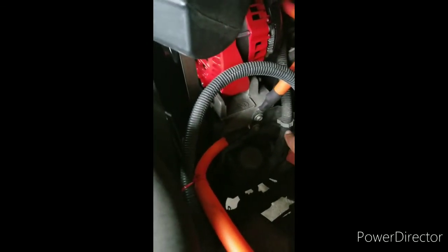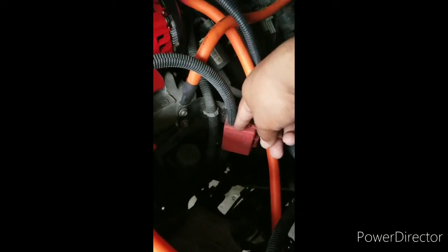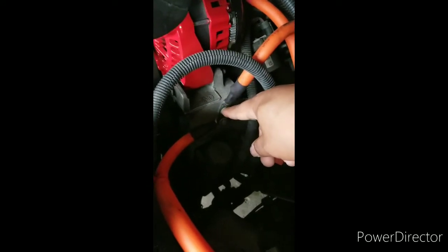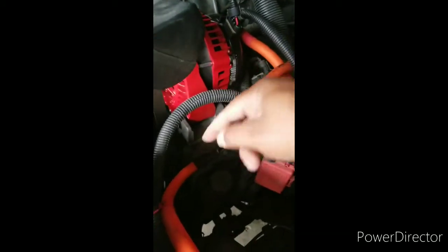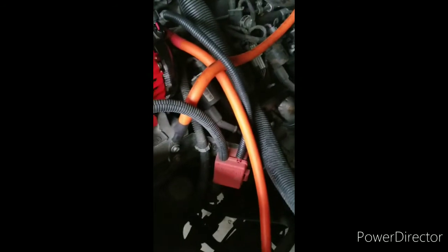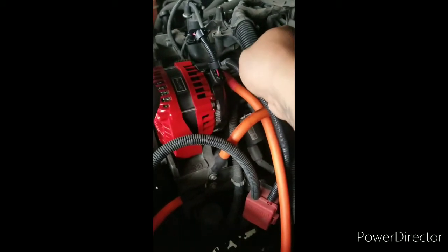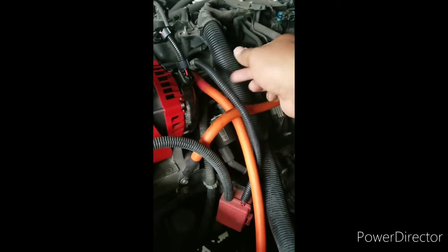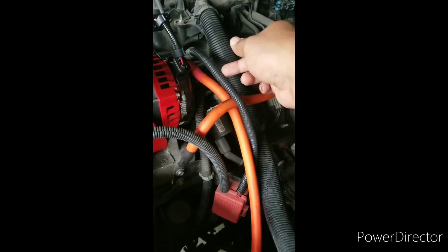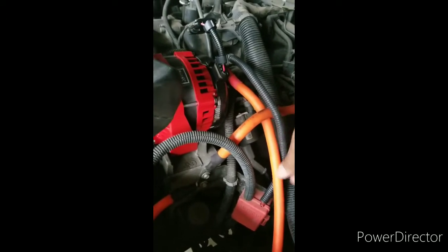Right behind the bracket that holds your battery cable. With zero gauge — this one goes to the body, this one to the battery. You'll also see the Brand X 290 alternator. The stock wire looked like an eight gauge — maybe less — so I upgraded that as well.